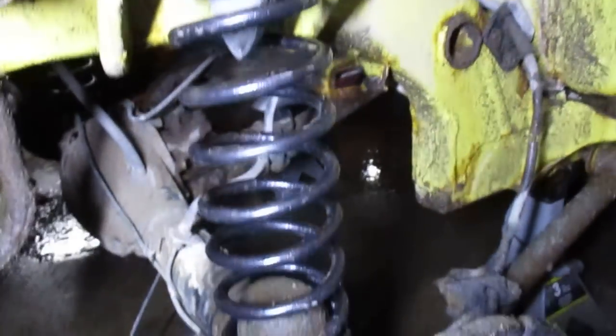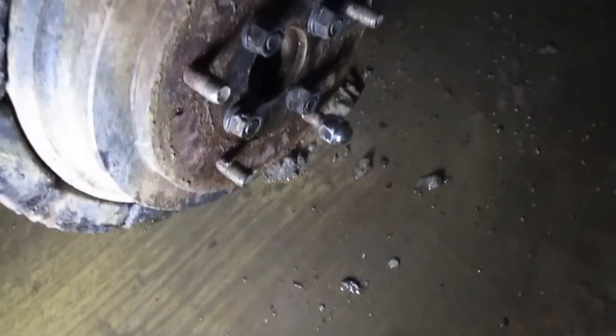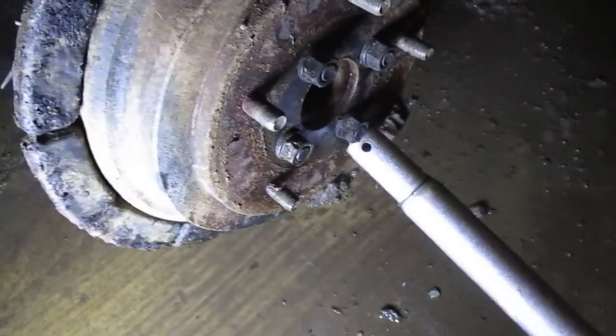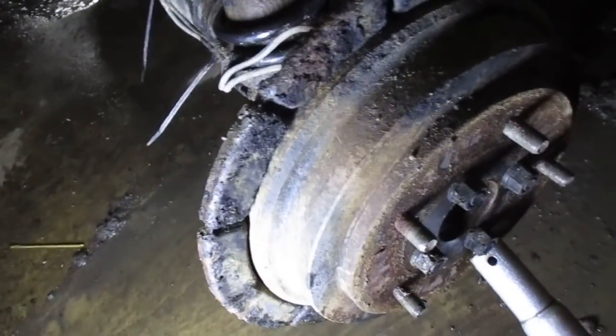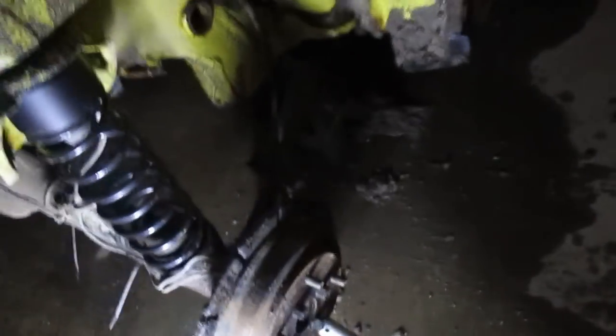The second side is usually a little trickier — sometimes with these trackers you have to do what you have to do. I have a piece of pipe, a.k.a. a jack handle, with a lug nut so it doesn't screw up my stud. I actually stood on it, bringing the axle all the way down to the ground with a little bit of pressure from the jack on the other side, and then had my helper fish the spring in. You could use a spring compressor, which I've used before, but if you don't have it, that seems to work.